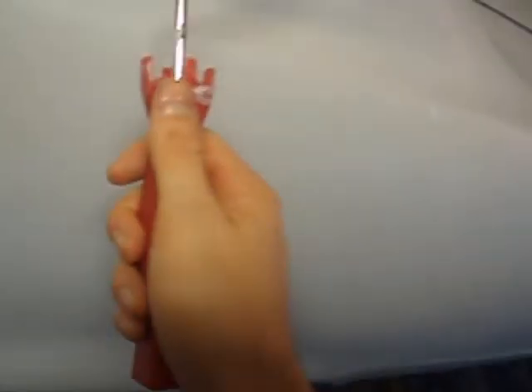This is my second coat. I'm just kind of touching it up. That's why I'm trying not to paint too much on it right now, because most of it's getting pretty dry. This is a little thicker than what most people do because I'm just doing the primer. I'm going to wet sand it at 600. It's actually 30-70, 70% paint — a little bit thicker than the 50-50 that most people do. I'm only doing two coats of the primer because it's covered really nicely.